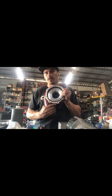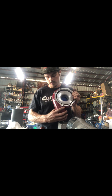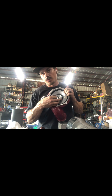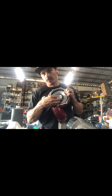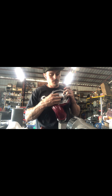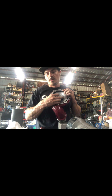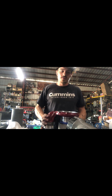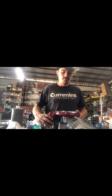That pressure recovery zone will move its way up as more of the diffuser gets used. At operating conditions, the pressure spike or rise in pressure is out here at the edge. But as the pressure ratio and flow rate get higher, that pressure recovery zone starts to move closer and closer to the wheel. It doesn't ever get right up to the wheel unless it backflows, but when those pressure signals get close to each other, efficiency starts to fall off and flow just stops gaining like it was before.